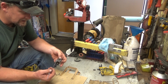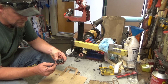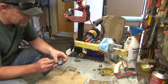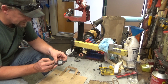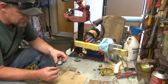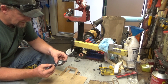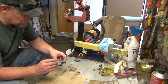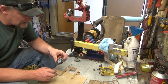of fuel. So the idea is when the pressure hits into the throttle bore right here, it's going to push that little disc up against the seat, and that bronze piece, brass, whatever it is, on the back side is set up to just catch that little disc and no leakage goes by. So that'll prevent a pulse from getting in the carburetor and basically pushing the fuel out of the carburetor and back into the tank. Now you can see why that would be a bad thing.